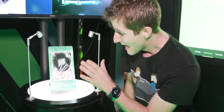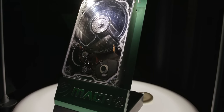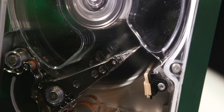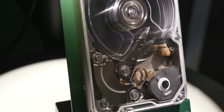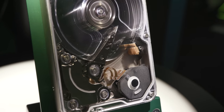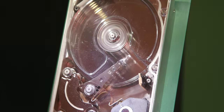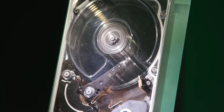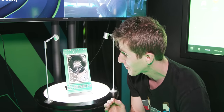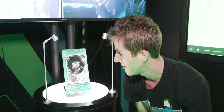Mach 2 is really cool. They've got a glass top on this drive so we can see exactly what's happening. In a multi-platter drive, most of the top platters here are glass so you can see two actuator arms moving independently of each other. It uses a single SAS interface, which takes advantage of SAS's ability to have two virtual ports available through a single cable and connector. The drive's firmware and processor take the incoming stream of data and split it between the two separate heads, which effectively doubles the IOPS performance compared to a normal drive running off a single actuator arm.